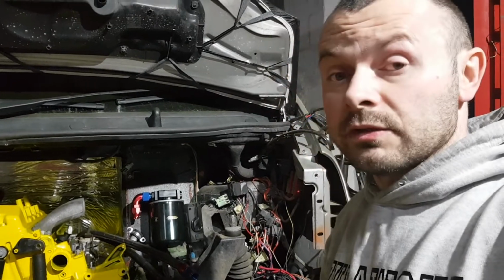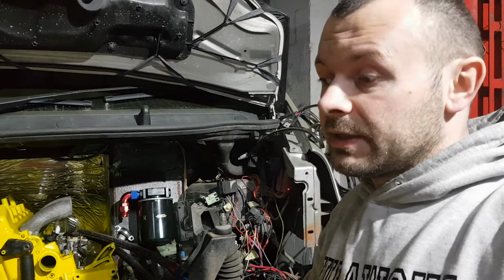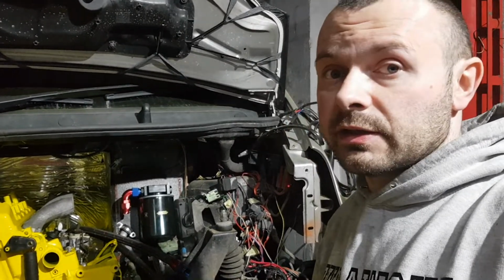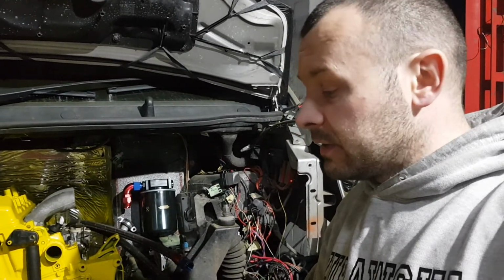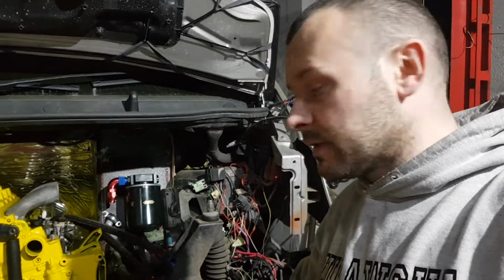With the bell housing obviously off, you can see the pump and the clutch, and I can confirm that it is different. The first clutch pack that you can see, removing the bell housing and the oil pump in the gearbox, is bigger, it is different, it has more clutches inside, more plates, so it's definitely stronger. So I'm really happy with that.